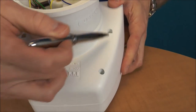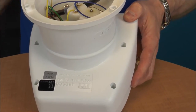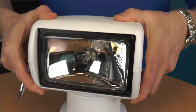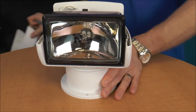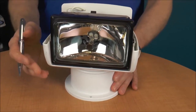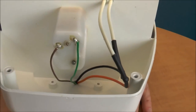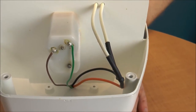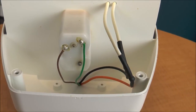On the underside, you'll notice that there's four screw holes. I've already removed the screws because they're long and you don't want to see me unscrewing stuff. By doing that, it pops off this top housing assembly. Now, in the back, you'll see the up-down motor. Same thing with the left-right motor — those wires are both negative and positive, reversing the polarity. That just makes the light go up or down.